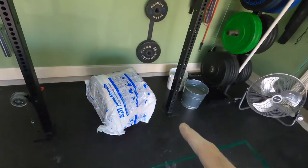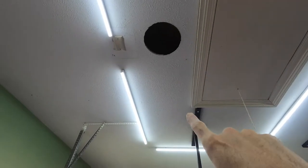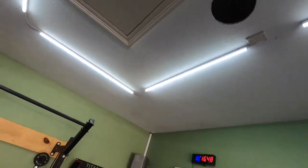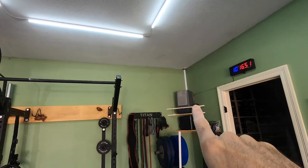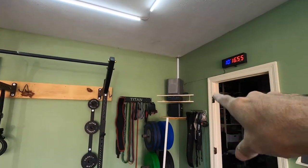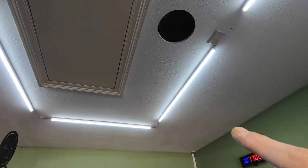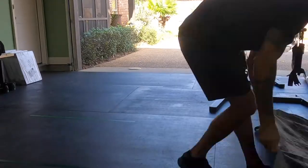Now I'm going to clean up, and here's the plan: I got the insulation on this side, so I'm going to stuff insulation in so it has a little sound buffer. Then I'm going to pull the speaker wires through - they're attached to the speakers - pull that out of the guard, run it through, and pull the wires through. Then put insulation in on this way too. I've got to do it on both sides. It should be fairly quick and simple - the insulation is easy to cut - and then we can mount the speakers in and test them out.